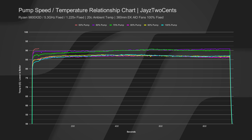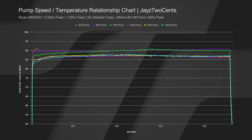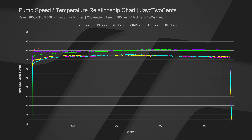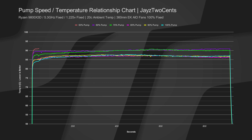At 60% pump speed, the temperature shoots up to just under 90°C — about 89.5°C — and climbs above 90°C by the end of the test. At 70% pump speed, temperatures started lower but eventually met up with 60% above 90°C and then normalized at just about 90°C. These are 15-minute tests. The AIO hits equilibrium in that time because AIOs have such a low volume of fluid. If you're doing this with an open loop with a large volume of coolant, you need to let it run at least 30 to 45 minutes or more, depending on the volume of fluid.